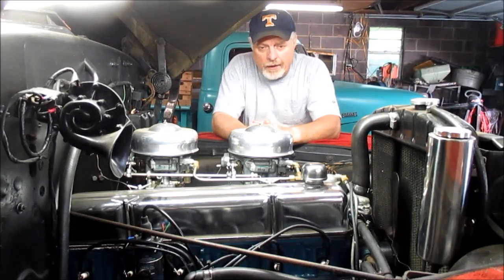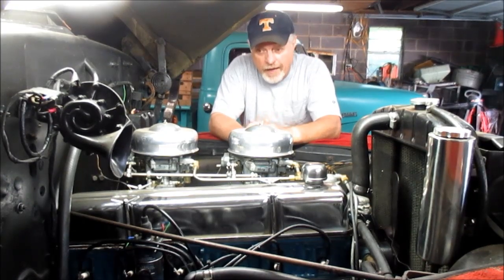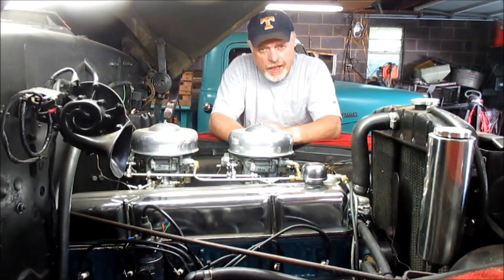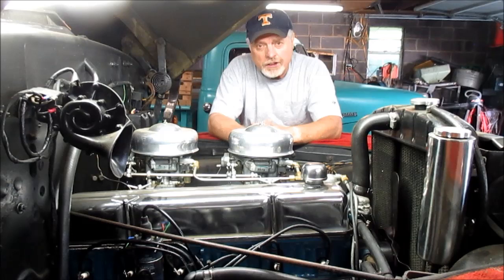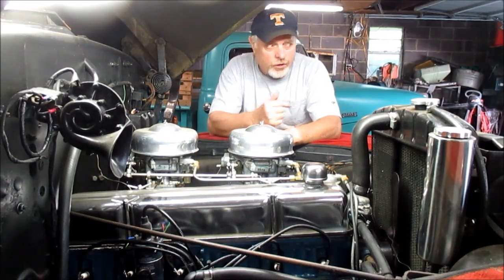And one additional thing, I am not going to pull this valve cover on this engine at this time and check the valves. The valves are not rattling, they're not loud, they're still as quiet as they were originally after I broke the engine in. I had an hour run time just before I installed it in this truck. I did one last run to drain out all the coolant, radiator flush and block flush, cleaned it out, and I checked and adjusted the valves at that time. Only a few needed adjustment, so I don't feel that the valves need adjustment at this time. But the manual does say to check the valves on a tune-up. And what I'm going to do is show that procedure over on the 216.